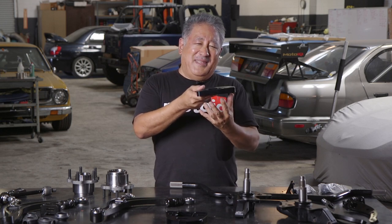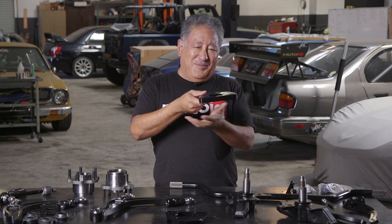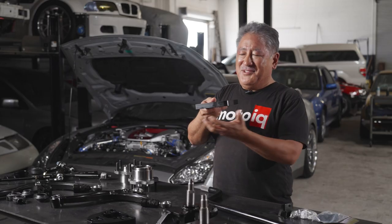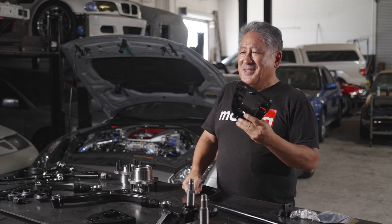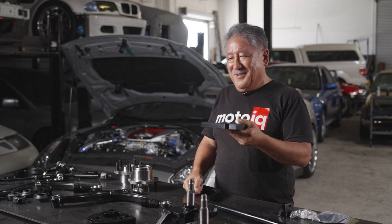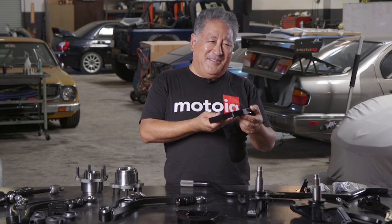A lot of you preparing your car to Formula Drift rules know that Formula Drift doesn't allow you to modify the shock tower past the circle of the three strut bolts, and that limits how much you could slot your tower to move your shock shaft. This thing lets you move it around without altering the top of the shock tower at all. You can maintain good geometry like your steering axis inclination angle — if your track width is super wide it won't get out of whack because you can move it out. You can move it probably a couple of inches back and forth. We used to have to custom make a CNC plate to do this on Dai's car, and the plate we designed is almost exactly this — but it cost a lot of money. Now you can just buy the same thing from GK Tech.